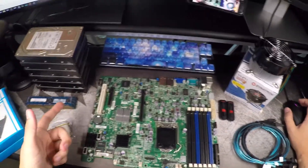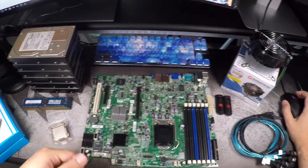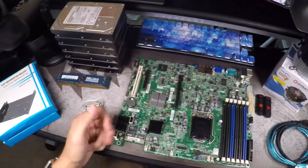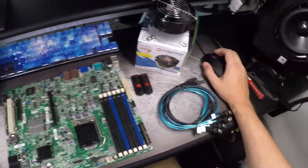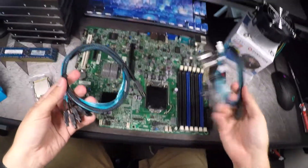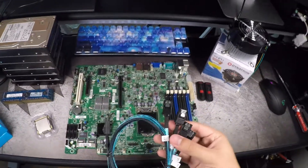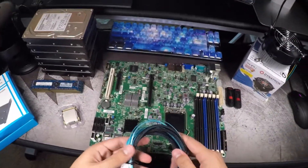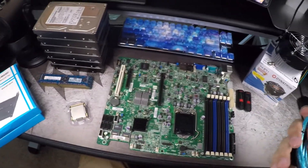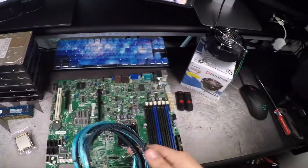The motherboard was $65. It was listed at $85 — I did an 'or best offer' at $65 and the seller instantly accepted it. The $65 with free shipping really can't go wrong, especially with the additional two SAS ports, which can break out into another 8 SATA, giving you 14 SATA total. And that segues into why we have these two cables — these are forward SAS breakout cables. They have an SFF-8087 connector on one end and then four SATA on the other. So long as we're using this in IT mode, it'll just give direct drive access — basically plug and play. We can do 14 total drives natively just from this board without adding a SAS card, HBA, or RAID card.